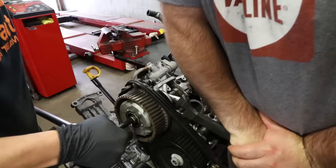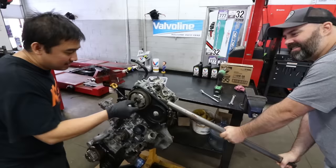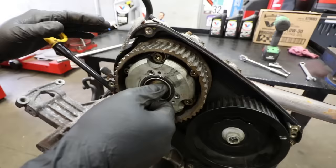He's lifting me off the ground! So now with Dave having a little more leverage with a pipe, we try again. Why not an impact gun? The problem with an impact gun, especially if it's seized, is that it won't have enough torque to crack it loose and you'll just damage the bolt — then you'd have to drill it out or cut it out with a torch.